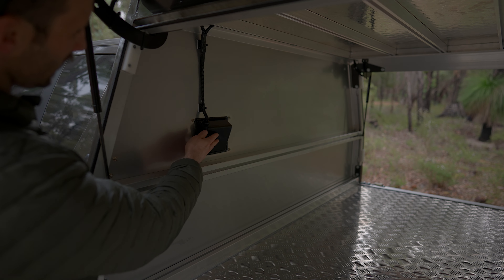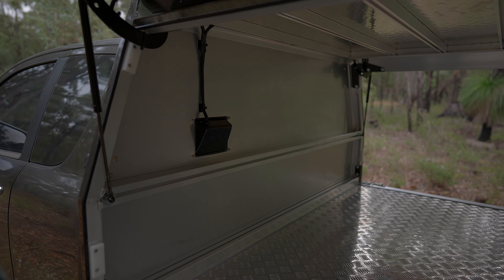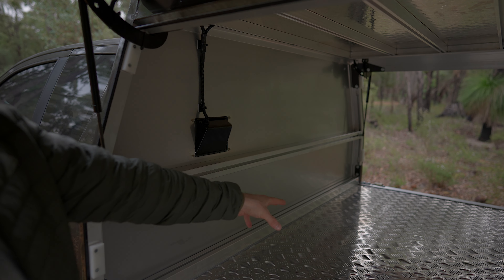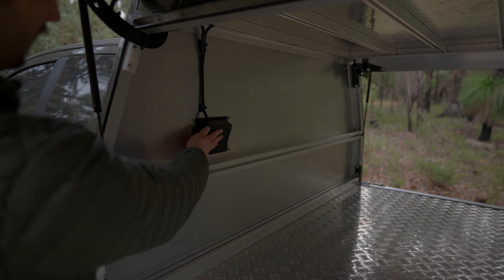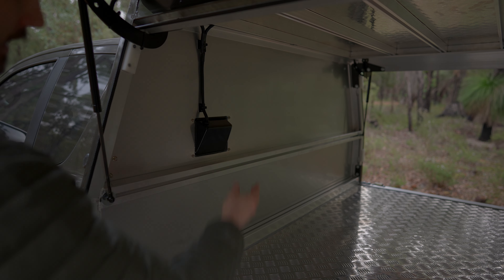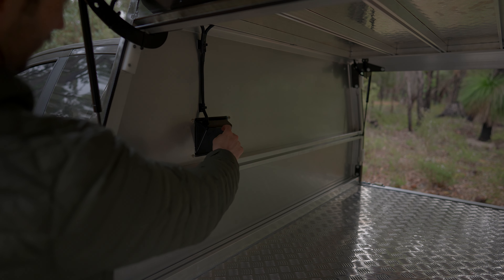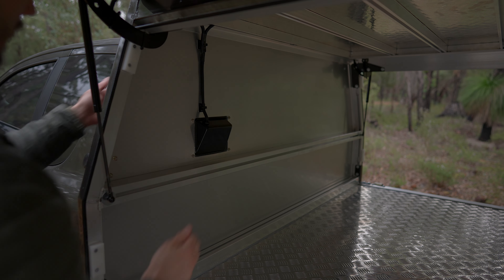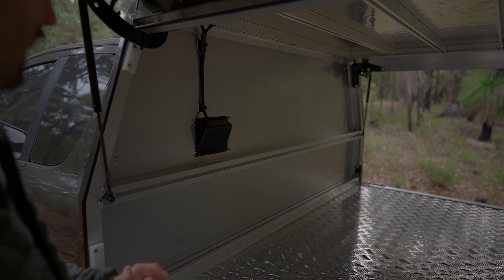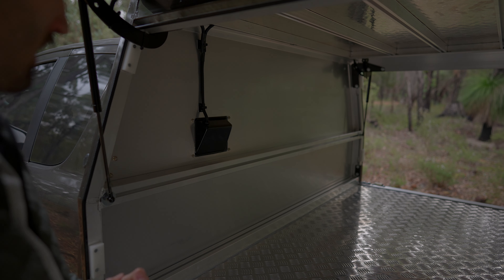This little hood is for bringing cables through — this is your central locking. I've got no 12-volt in here at the moment. I'm going to make up a headboard and fit a battery, keeping the weight in the middle. This is where I'll have my 12-volt supply come through, feeding a BCDC or battery manager, and I might have an outgoing cable running to an Anderson plug that fits on the headboard so I can attach and detach solar panels quickly.